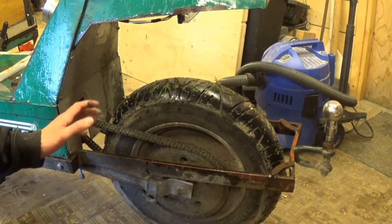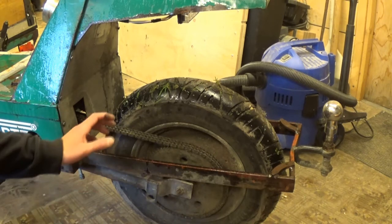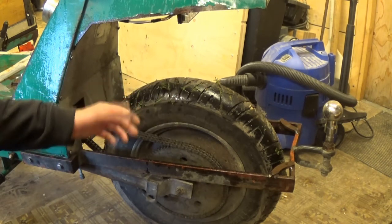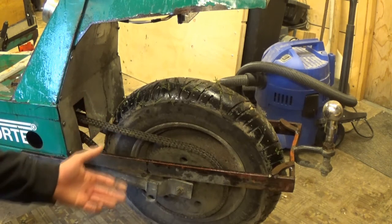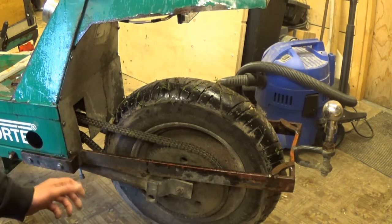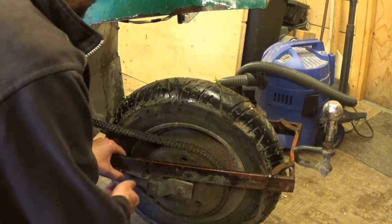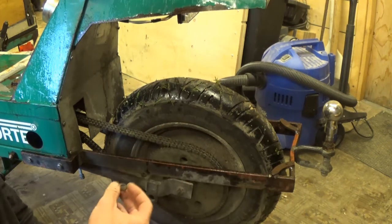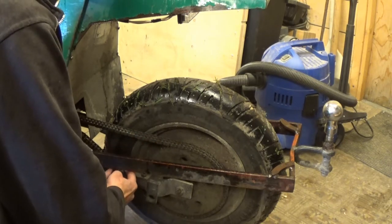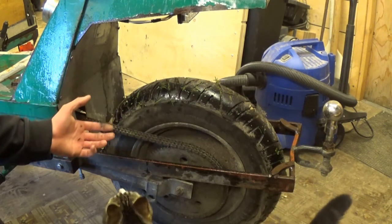So it works fine on these gravel roads that we have around here, surprisingly. But someone's changed the back tyre, obviously, probably because the back tyre was worn out, and they put this one on, and it's probably the only one that they could get, and it's a little bit bigger. So I need to make the fender sit higher up, and it's got nuts that are just sitting here on the frame where it bolts down, to make it a little bit higher. This actually worked fine until I inflated the rear tyre, and then it didn't just grow at the bottom, it grew all the way around.